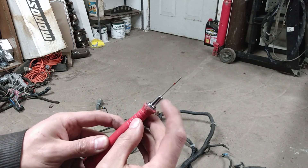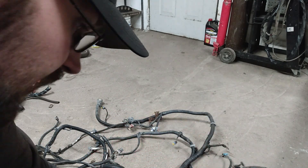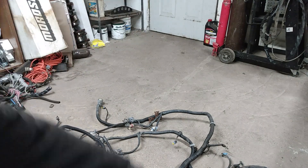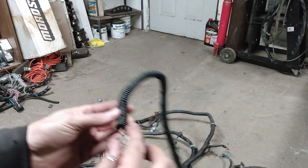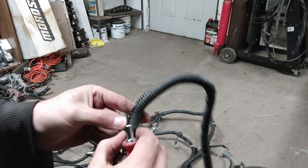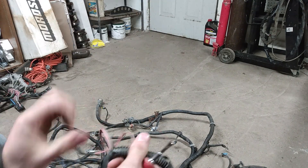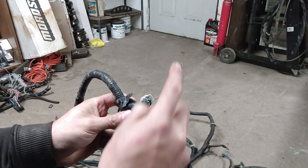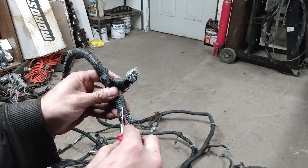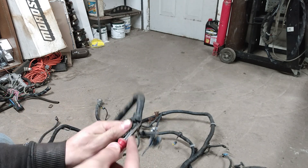So this is a tool I saw — I made a couple of them. I bought these separate and had a fine handle for them; I glued them in. Just to show you what they're capable of doing — we'll get a piece of this harness and start down here. Usually every time I try to use a razor blade on this, I end up cutting a wire, which you don't want to do. So you stick this red ball end in — so you can't cut anything beside what you're doing — and then you just slide it up and it just cuts right through it.